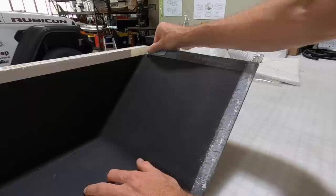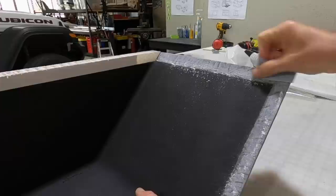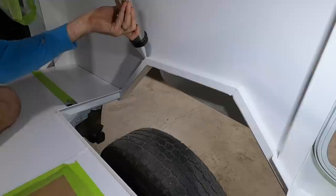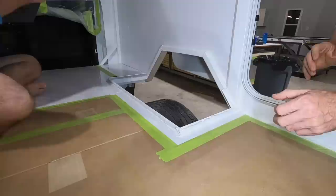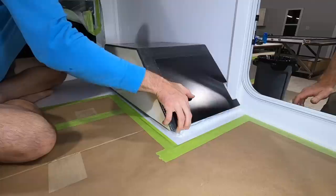With the forward floor bonded in, we can now also bond in one of the wheel wells — for now we'll do the passenger side and get to the driver's side a bit later. Michael made these out of carbon fiber. Just like all the other composites in this project, we carefully prepare it for bonding by scuffing it up, cleaning it with alcohol, hitting it with activator, and then bonding it in with our special glue. There are no bolts holding this together — it's all glue.